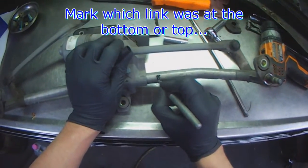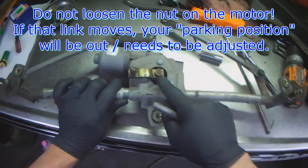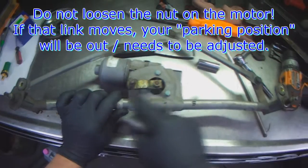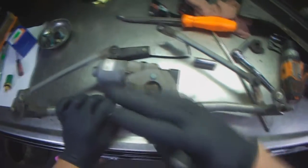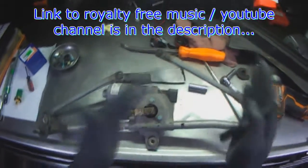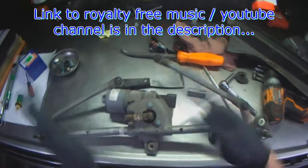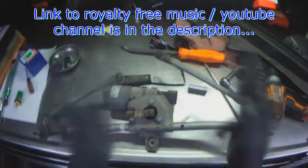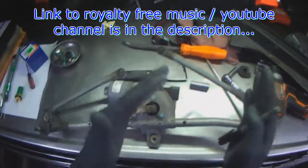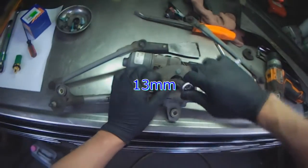As a reminder, I'm going to write down 'bottom' and 'top' — this one was on the top, this one was on the bottom. You don't want to loosen this nut. You do want to check that it's tight, but you don't want to move this lever because when you move it you're going to mess up the parking position of the wipers.